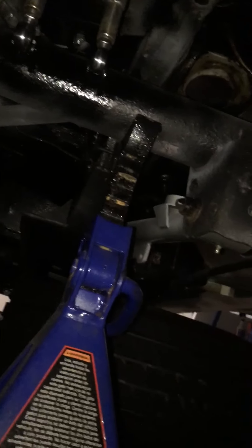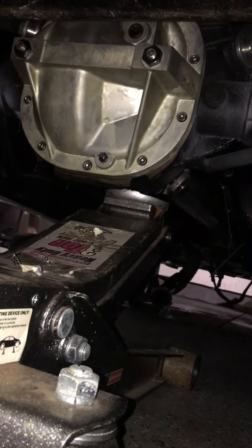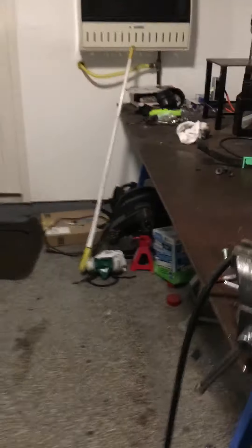Additionally I did a dual anti roll bar kit — two on each side, welded to the sides right there. Before I deployed I also did 35-spline axles with a spool in the middle and 2.73 gears, so it's coming along.